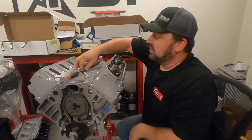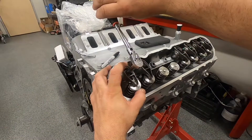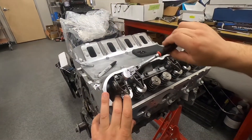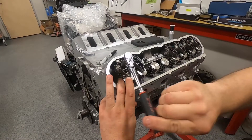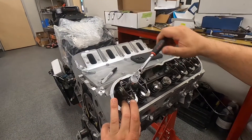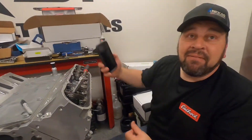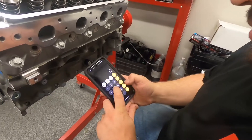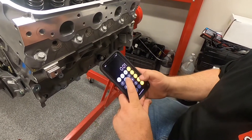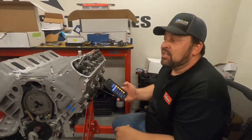Sometimes the intake is a little bit different, so while we're here we'll check the intake. That's a quarter turn, half turn, three quarters, one full turn — five quarter turns total. So that one's going to be closer to 95 thousandths. Five times 0.0184 is 92 thousandths. So intake is 92, exhaust is 101 — can't get much better than that.